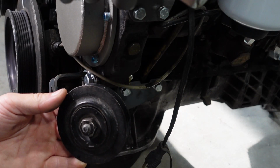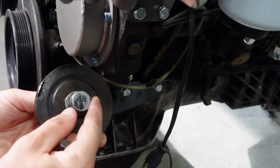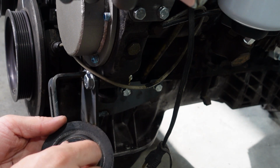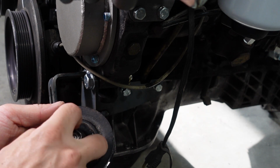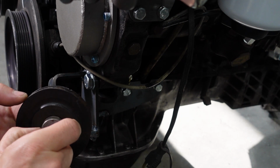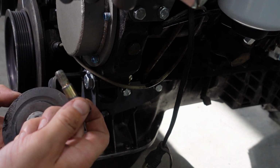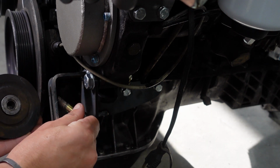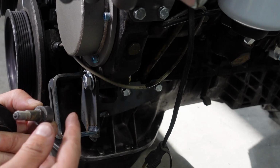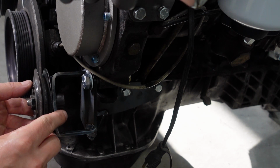Next you'll need a tensioner idler pulley from a 22R setup. So this has a special bushing in the back that's threaded, and this long tensioner adjustment bolt. So this has a nut on the front side and a washer plate. On the back there's going to be a bushing. It's doing the same thing as our custom bushing that I machine. Up at the top it's just locating. It's a nice loose slip fit, and then this goes through it. So you put this through the bracket, and there's a little indexing shoulder on here that keeps it clocked so you can tighten it. So we've got our nut bottomed out, but we have it loose enough that we can slide this.